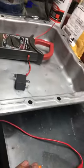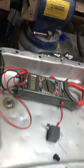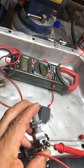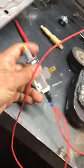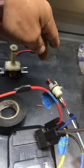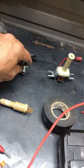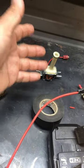As soon as I hit the brake switch it's going to cut power to this one over here — it has power all the time, torque converter can work, and when you hit your brakes it cuts the power. There are two ways you can run it. These switches are actually pretty cool — I've been running one in my car for about 18 years and never had any problems. You need to get power from there through here to your transmission. This goes in your transmission and then it's going to run power directly there. This goes to your ground on your fourth gear lockup pressure switch.